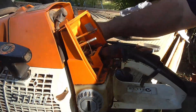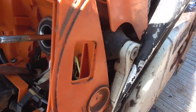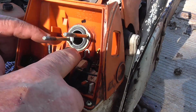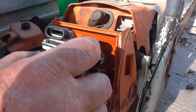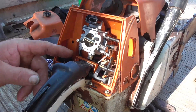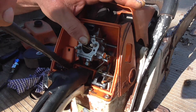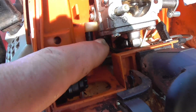It's now time to put it all back together. The first thing I've got to do is put this little hose back in the tank hose. That actually goes in quite easy and because it's a little bit bigger than the thing it actually helps hold the tank hose in. So we have to make sure that this tube here and this tube here actually get hooked up when we put the carburetor back in. We've got our carburetor and the bottom hose slid straight in that one down there. This one here we've got to put on — hold my thumb against it and grab my pliers and put that hose on. So you can see now this hose is on and the one underneath is on, so that's correct.